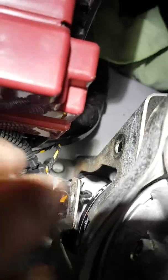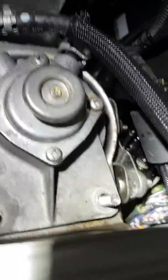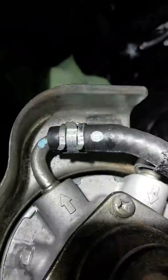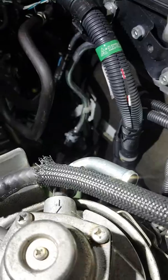What you've got to do is down there, you've got to take that bolt out down there. Got to disconnect these two bolts here. Pull the larger hose off — it's just got a press fit sort of clamp like that, just pull that off. Have a rag to hand, there'll be a bit of residue there.